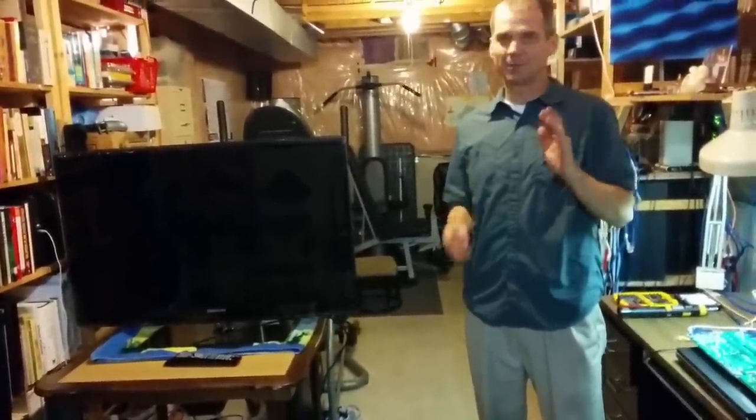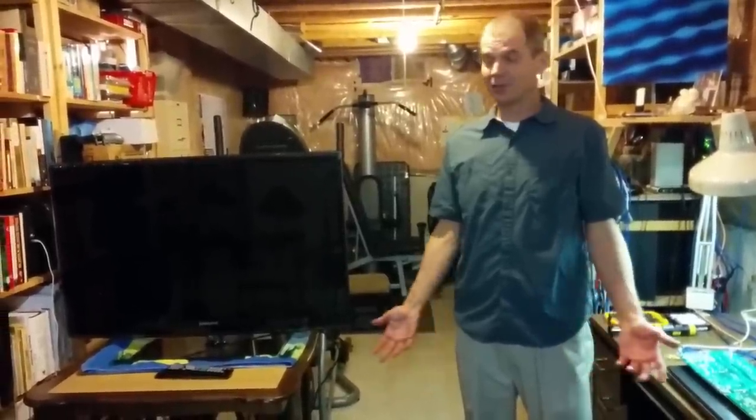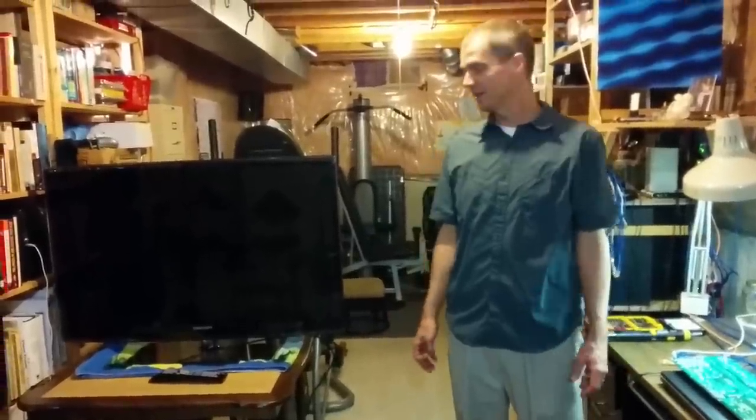I wanted to continue to work on it and continue to fix it, and I found some excellent videos out there that suggest that it might not just be this, it might be the compact fluorescent tubes themselves, or the lights themselves. They might get a little old and start drawing excessive amounts of current, and it's not that obvious. I saw it only in comments on YouTube, and I actually haven't found any videos on how to disassemble the TV down to that level.